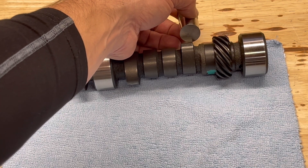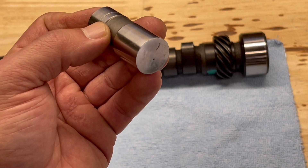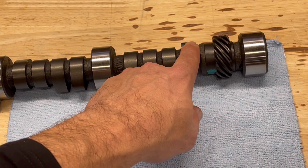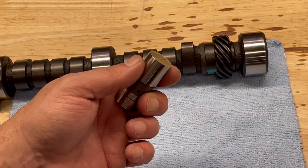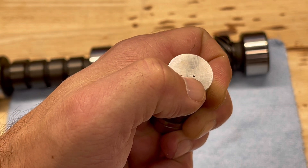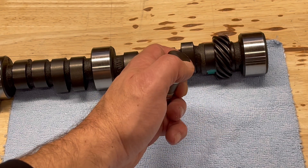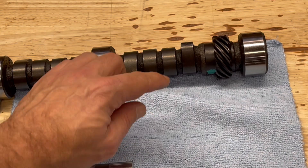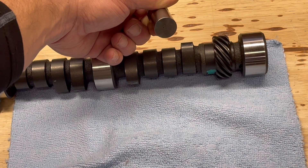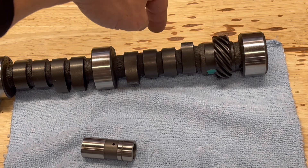That's really important because we keep hearing about lobes getting wiped out and lifters going bad, as discussed in the last video. This lifter doesn't completely solve that, but it does add that extra bit of oil between the surfaces. Looking at this lifter, the hole is not completely centered — I've seen them centered too — but after research, that offset is due to the taper of the cam itself. When it sprays on there as the lifter spins, the theory is it's getting lubrication to the entire lifter face. The radius of that hole almost matches the camshaft lobe profile, so as it rotates it's spraying oil across the contact area.